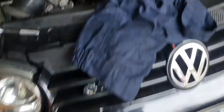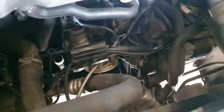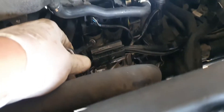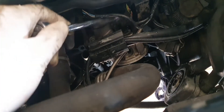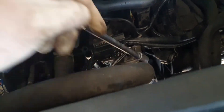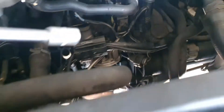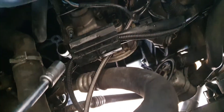I'm gonna do this methodically and give it a good wipe first. I've pretty much got the bottom two nuts on. I'm gonna get these two 10mm on. I've got the PCV elbow on already — just need to put those two support nuts on. The infamous reason why I actually rounded out the oil feed is because the aircon hose didn't give me a lot of room. So I'm gonna have to bend it out of the way because I'm not going through this again.